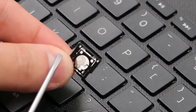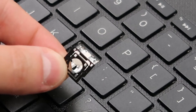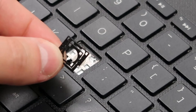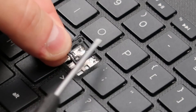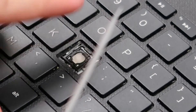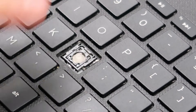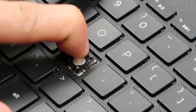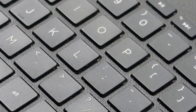Don't be too freaked out if these parts come unfastened from each other — sometimes they do. It's painstaking but you can get them back together as long as it's not broken. To get it back in there, go in reverse. We took it off top first, so we put it in bottom first. Set the key in there, set it down nice and even, nice and symmetrical. Get these bottom metal clips in where they should be, and once you do you should be able to just push on the top and snap it in place. Once that's in place, put your key cap on, try to get it centered, and just push. And there you go.